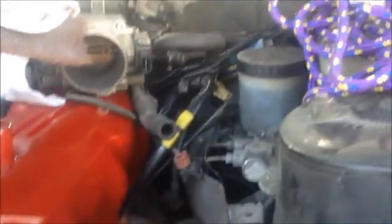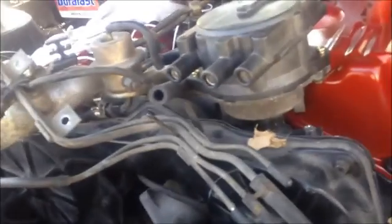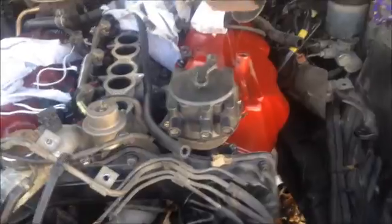Motor's finally dropped back into place here. We're not on the ground yet, but the jack is not supporting the motor anymore. Got both in — there's a little bit of an issue, but that's what you have to expect when you're just moving around an engine. It moves around quite easily, so it shouldn't be a problem if you decide to do it. You have to move the control arms and the sway bar and unbolt them, then move this bar over and it'll just drop out of place. I have jack stands under the main body of the car on the rails — that's what's supporting it — and I just use the jack to jack up the engine to move it.